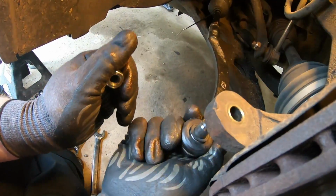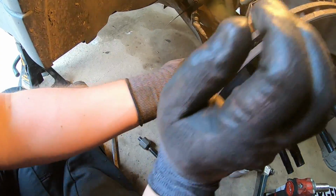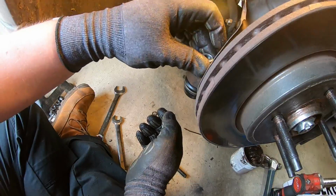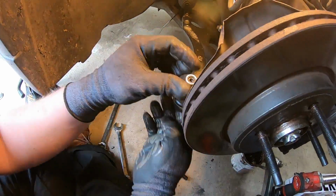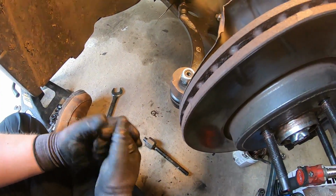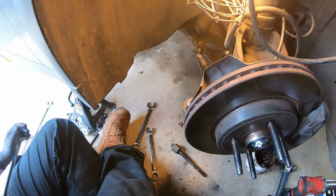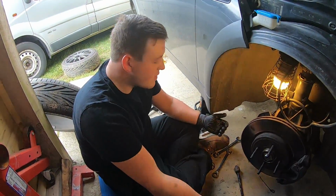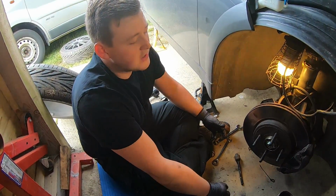So just go over to your hub, your upright, shove that back in the hole, put the nut on, do it up, torque it up. I'll leave the torque down in the description, and then that's it. So obviously you want to repeat that process on the other side. It's a fairly simple job really if you've got the right tools. I'll leave a list again down in the description.